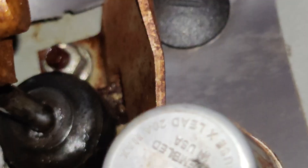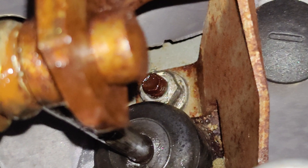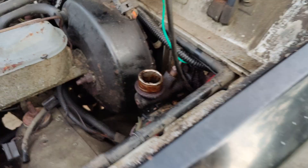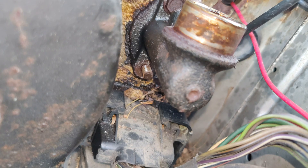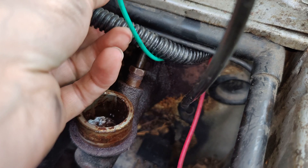If we take a careful look in here, we can see there's a nut way up there. I'm going to try to remove it from the back because this is probably where people have their issues — if you look up there, that's definitely a stud. There's no head on that side. I couldn't tell if that nut was a 13mm or a half inch. Half inch seemed to fit it a little better but I couldn't get the six-point on there. This hose has zero up and down movement from what I can tell. I can't get the damn thing to even wiggle a little bit.